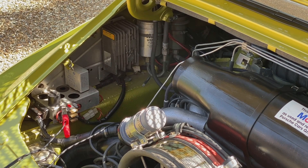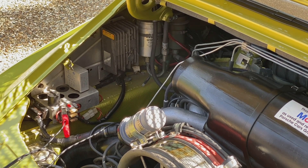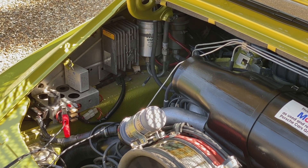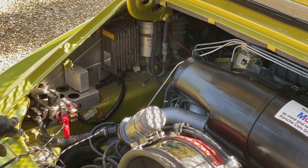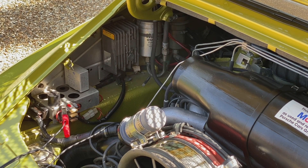So firstly here's my SC with the standard ignition box, and I'm going to show you how to swap over to one of our CDI Plus units. I've got a timing light connected, so I'm going to start the car and just see what the timing is doing. The timing is running at about two degrees before top dead center, which is in the ballpark — the spec is five degrees plus or minus two. So let's go and swap to the CDI Plus unit.